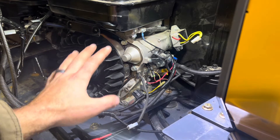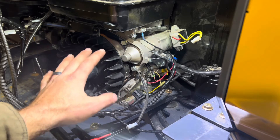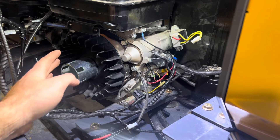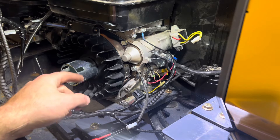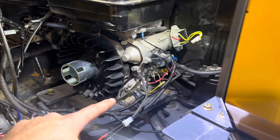This engine is a 13.5 horsepower Briggs and Stratton and has a multitude of different alternators that can be put underneath the flywheel — DC only, DC/AC, and AC only. The one on our mini excavator is a 10-amp AC alternator. I know that because Briggs and Stratton has a chart on their website covering all the different wiring colors, connector colors, and how to identify what type of alternator you have — and using that chart it comes down to a 10-amp AC alternator.